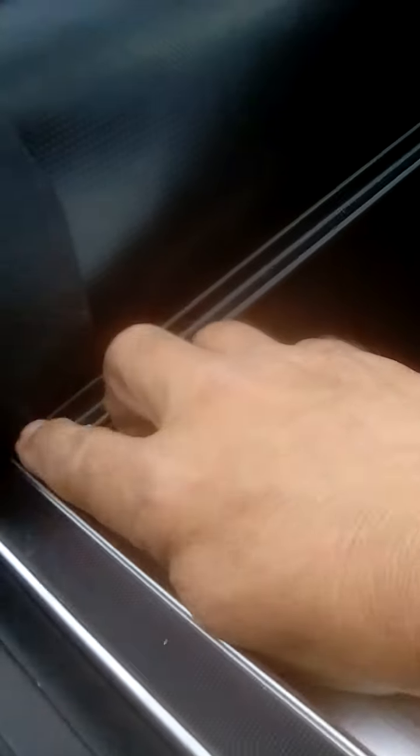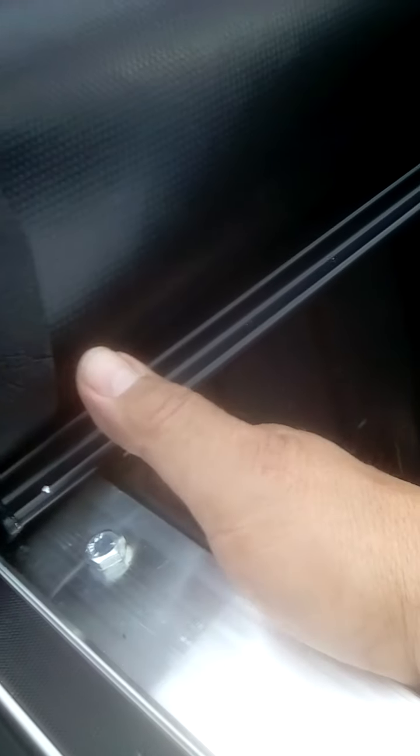Coming to the front of the truck, this right here is all one piece. You just center it up on top of this bar — as you can see, it is right on top, about a quarter inch on each side. Then underneath it screws into place. There's nothing to bolt here, but underneath there, if you have any tensioning issues, you unscrew this or turn it clockwise or counterclockwise and that will make more or less tension.